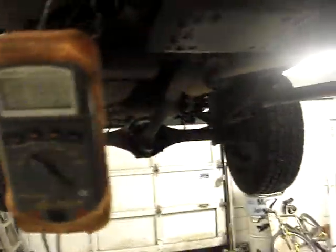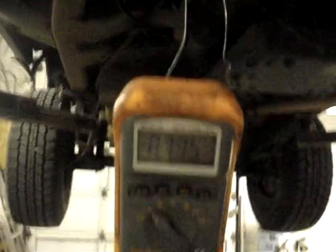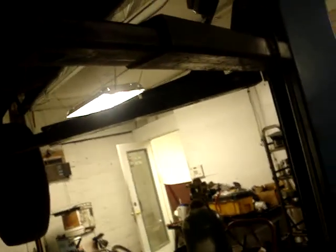Right now it's running high 0.7, 0.9 volt, or 0.8 volts. It's still running fat. My idle circuit on my carburetor is clogged, so I can't get a leaner measurement right now. I got to take my carb apart. I'm going to block my hole off, and it jumps right back up to the 0.9, kind of where we were last time. Okay, now let's add the HHO.